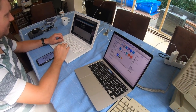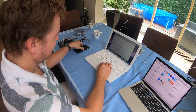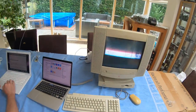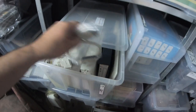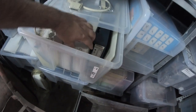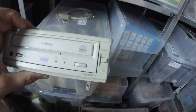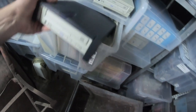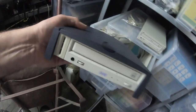We're downloading Adaptec Toast on an old MacBook that still has a CD burner inside, hoping to get it onto a CD. I'm fetching a CD drive with SCSI to connect to this Mac from my box of SCSI goodness. I'm trying to find a burner that doesn't need a caddy to load a CD. There's a Yamaha CD recordable/rewritable drive, but that has modern connectors. So I'll take the other CD recordable that has the right cable.